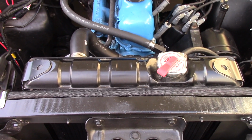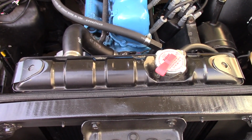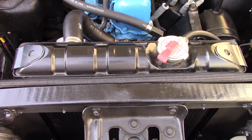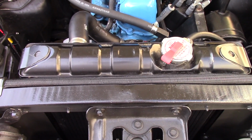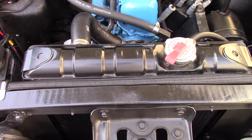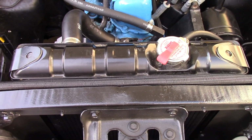That means that when it's 90 out, if I go to drive it up there, it's going to overheat. That is absolutely a radiator capacity issue, 100%. I don't care what anybody says. The fan was running 100% because at 205 degrees, I have it set to turn the fan on 100% no matter what.